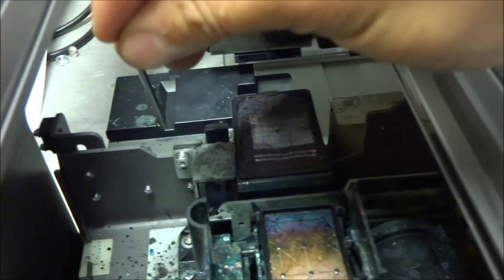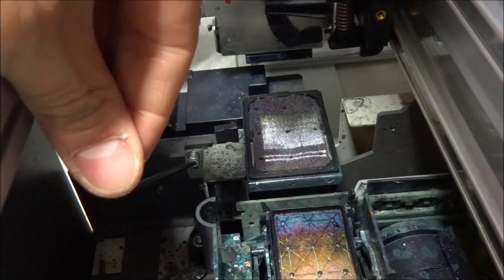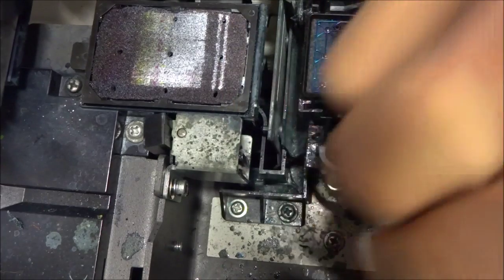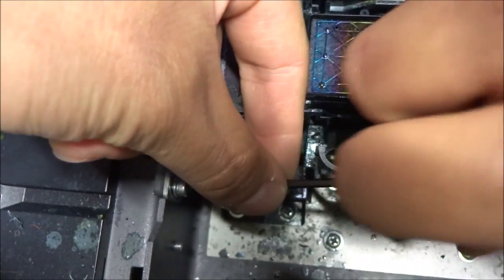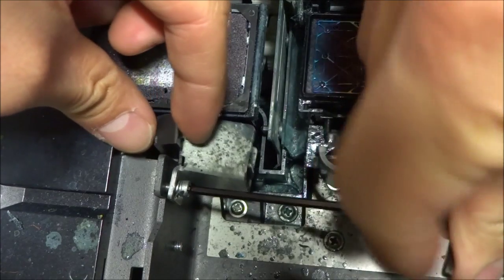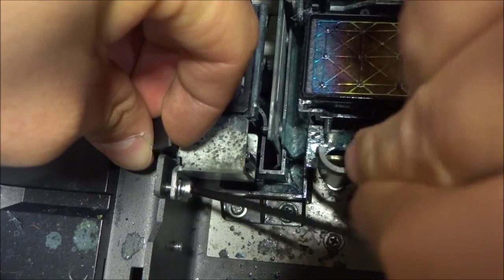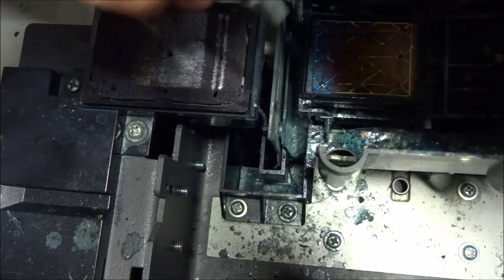In this example we're going to have to take this locking solenoid out, and with the ball-ended I'm able to angle this a little bit and get this off. Just be careful that if this screw falls, make sure you push up against here. You can slide this out while holding this so it doesn't go flying everywhere. This way I'm pushing up against it and it will come out in one piece.